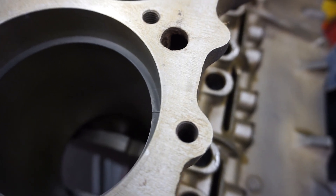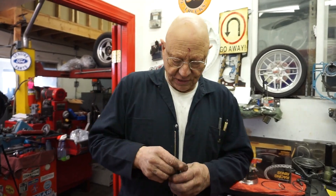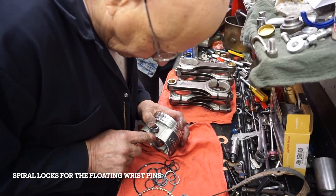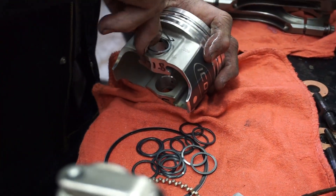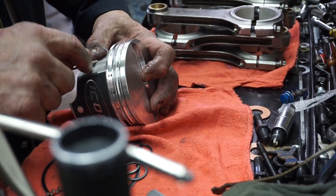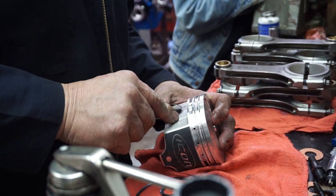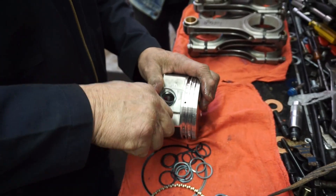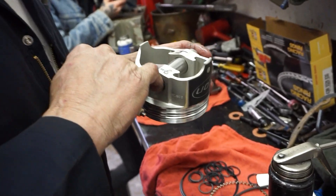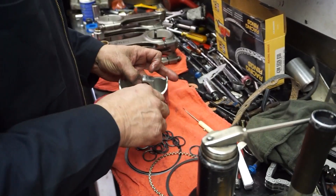But you don't want them to expand so much that they actually butt up against each other and bind, because that would be very bad. If they close up, it will wind up cracking the top ring land of the piston and start breaking stuff. But there's several different styles — these ones look like little pigtails. The idea behind them is they make several laps so they're overlapping each other, so they won't walk out. The single locks can — the end will be up in the bore a little bit and as you put the pin in, it pushes back into the groove and a lot of times you'll get a snap, so you know for sure she's in.